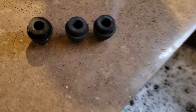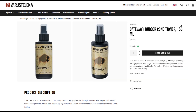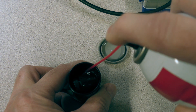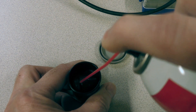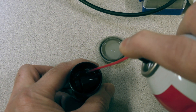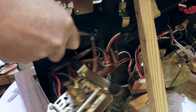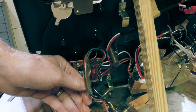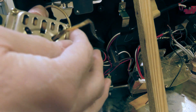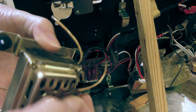I looked into various methods to rejuvenate the rubber, but most of them looked like snake oil treatments. The method I chose was to soak the mounts in silicone lubricant for a few minutes to keep the outside lubricated and ward off further deterioration. While I was working on the motor mounts, I noticed that the oil tubes from the turntable base plate to the motor had hardened and cracked. This could also contribute to the rumble by telegraphing any motor movement to the base plate, so I decided to replace them.